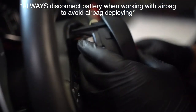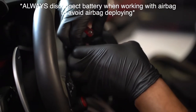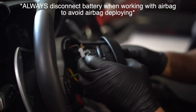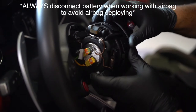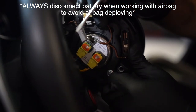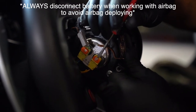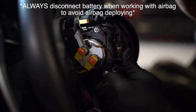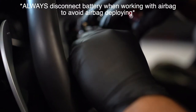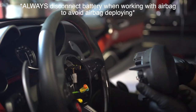The next clip is on top of the airbag — release this clip and pull out. Lastly, there are two more charge connectors on the back of the airbag. Same as before, with a pick or a flathead you can pop both loose and remove. Gently wiggle them out, and that's it — airbag is out.